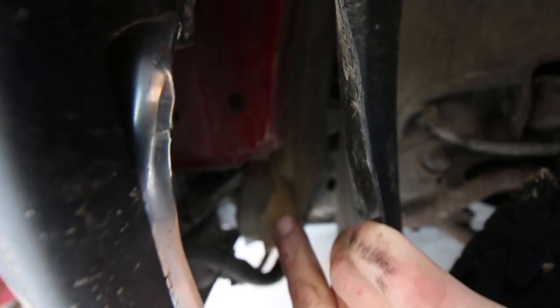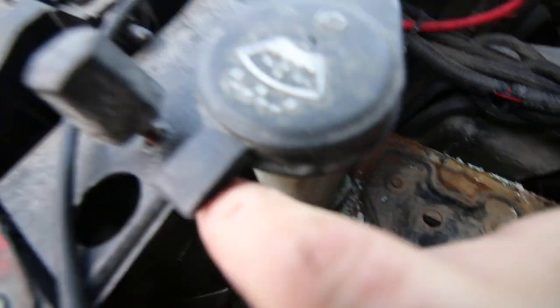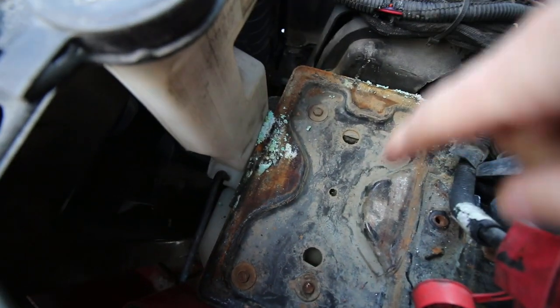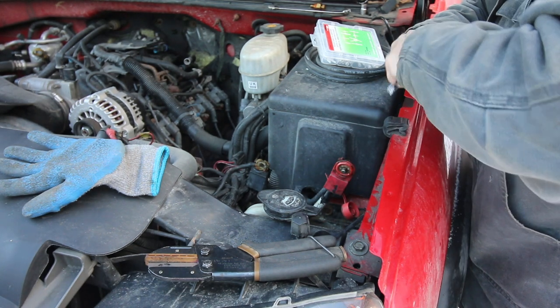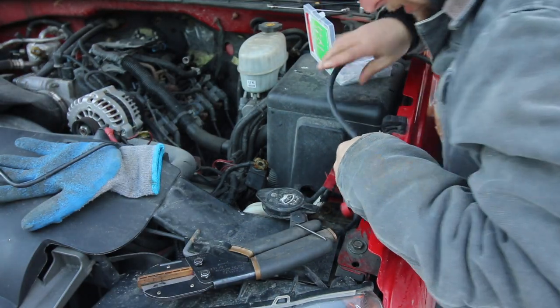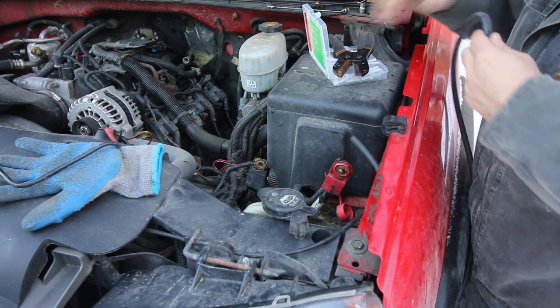I was hoping once I had this all apart — right here's my windshield washer bottle — I was hoping I could squeeze my way to the side where the pump is, but I can't. From up here they've got it weaseled in between the radiator support and the headlights, and there's no way of getting in there unless we take the battery tray all out. So for today I'm going to cut the hose, put a union in, and join it back here to this factory fitting — they give us a nice connection with a barb fitting, and I'll do the same on the bottom, joining them both together down below.